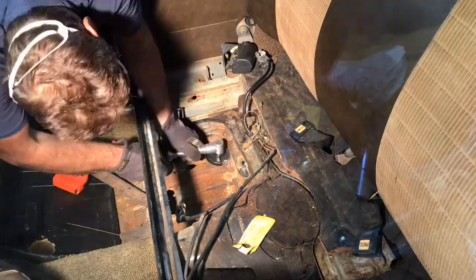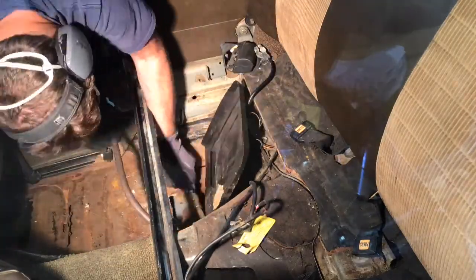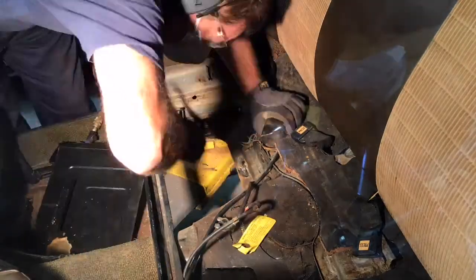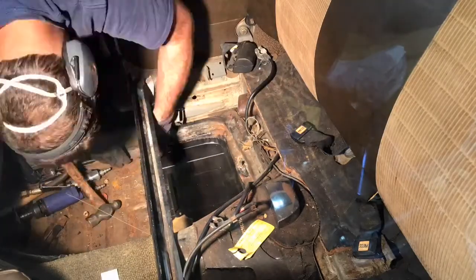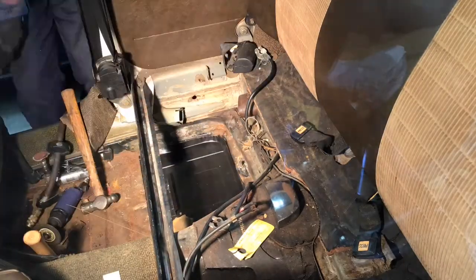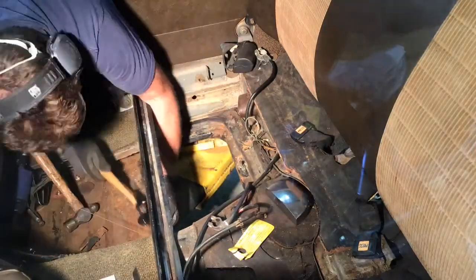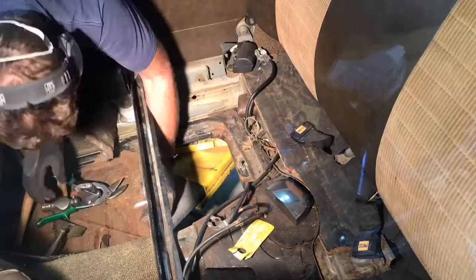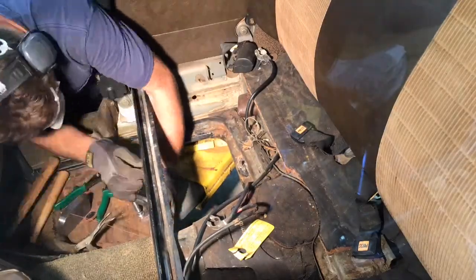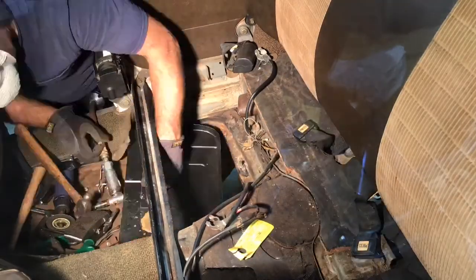Repair, pretty straightforward. Cut the old one out. I had to remove the tube that goes for the heater control cable first. I didn't show that in the video. An air-powered cutoff wheel works the best for cutting the old tray out, and I used a pair of tin snips to neaten up the edges. I cut the hole so the tray would be about 1/4 inch of overlap all around to give me a little bit more solid metal to weld to.